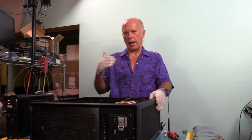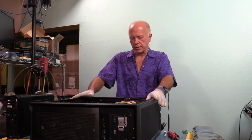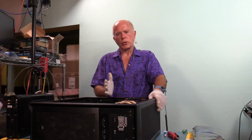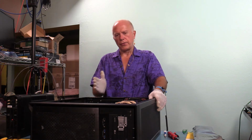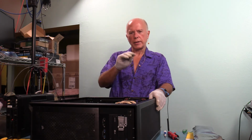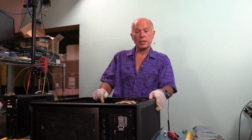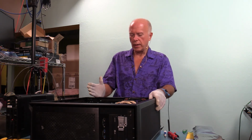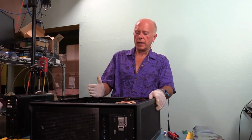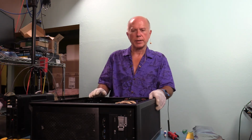It's just that I like doing those because the Windows Media Creation tool is different. For example, when this class of machine was built with the X399 chipset, the version of Windows we had at that time would blow up on you and you would not get an install finished. And all the stuff everybody else said to do was not the way to do it. The best way was to take the drivers for that particular Wi-Fi card, because we upgraded the Wi-Fi card, and slipstream those drivers. Going forward with the new build of Windows, with the new Wi-Fi card that's out, Wi-Fi 6 I believe, same problem. You've got to slipstream the drivers so you can get a clean install and don't get a BSOD.